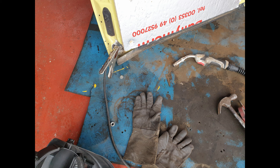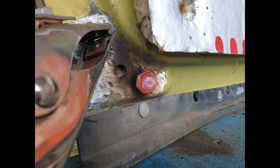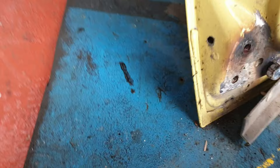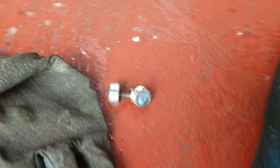This is another task that I never liked doing but it needed done. When you open the van door you can see the hinges were contaminating the door itself. The bolts had to be removed with heat, so I welded nuts onto them and moved them back and forward until they released and fell out. A short video clip demonstrates this. I was careful making sure not to damage the paint working outside the van, because I wasn't originally planning on painting the sliding doors — but clearly I went overboard.